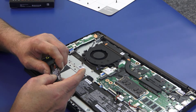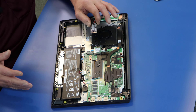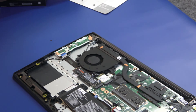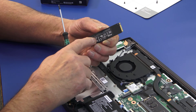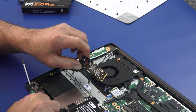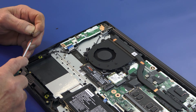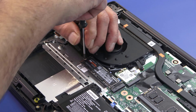So now I'm going to put my brand new empty drive in, because I am going to do a clean install on this. You could clone it with a cloning process — there's lots of ways to do it — but in this case I'm just going to do a clean install. On the bottom of these drives they've got a copper heat plate to spread out the heat. I don't think I'm going to use the thermal pad on this because the label across the top also serves as a thermal pad. This is not a gaming laptop at all, so it's going to work just fine. Get my screw back in there.